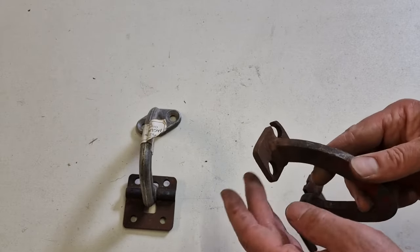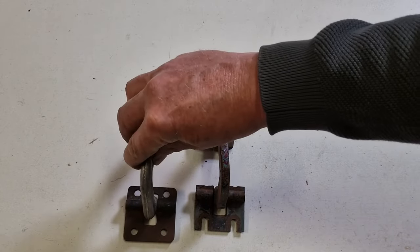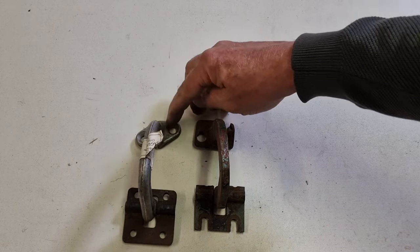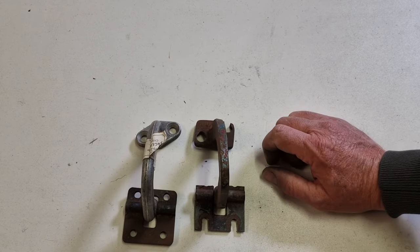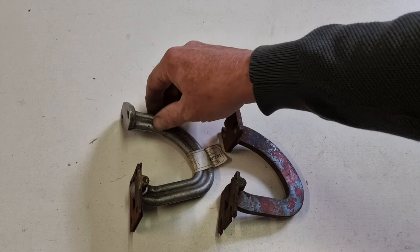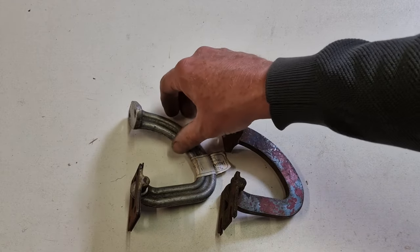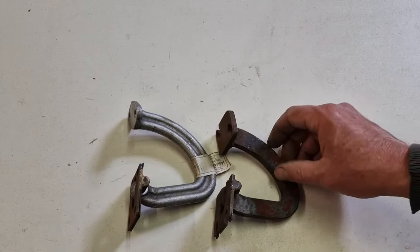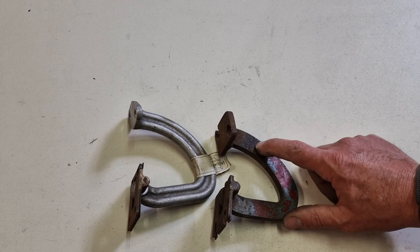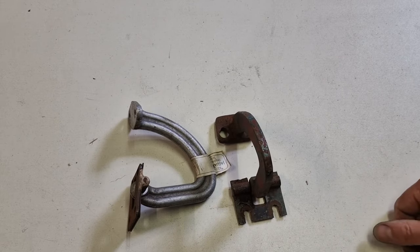So the main issue is the tailgate. You cannot mount these on the tailgate of an early car. You need to have this one with a flat, and this is a special shape cut out on the tailgate, and on the early cars these are flat. And so when you see these, then you have a later one, which was later covered with covers to make it look more beautiful. They were covered with vinyl or leather and or moquette. The very early ones, 61, very early 62, were not covered. They were a bit raw. But that's how Jaguar was. That's what we like.